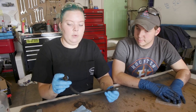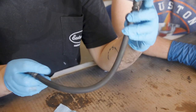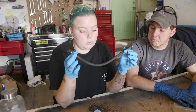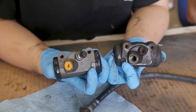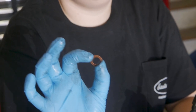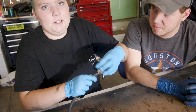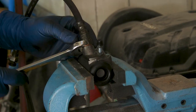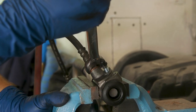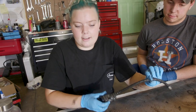One of the things we were going to double check and possibly replace was this brake line, but ours is really flexible still and looks like it's in good condition, so we're just going to use the old one. We double checked that our cylinders are the same, and now we're just going to put this one on — it has a little copper washer. Seems pretty tight. I think it's tight. So now that we have this line on, that is done.